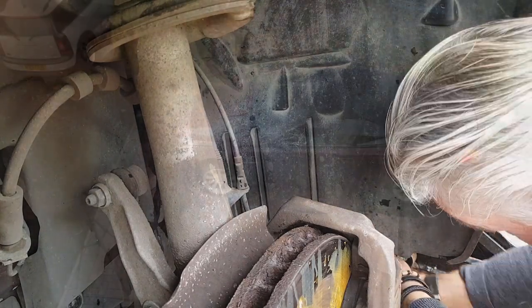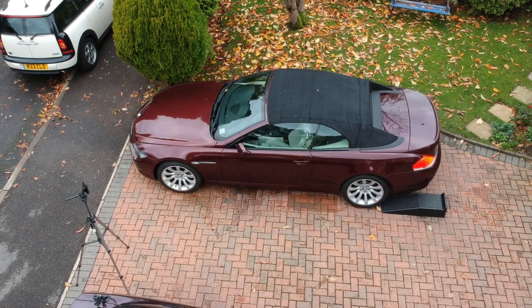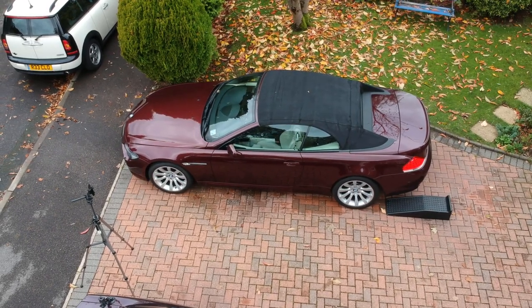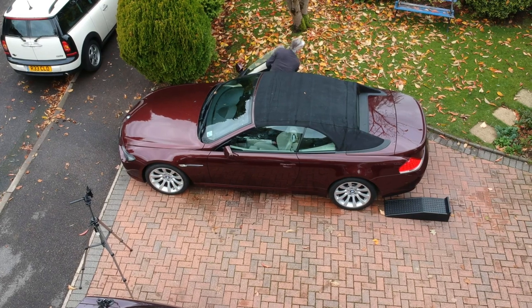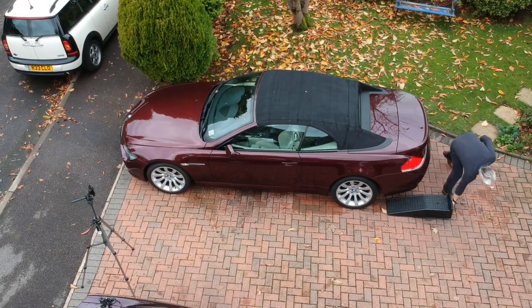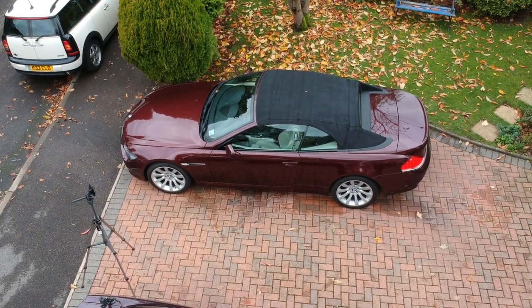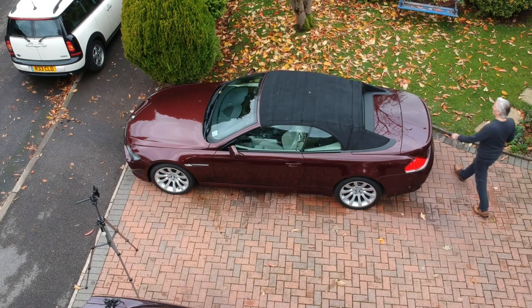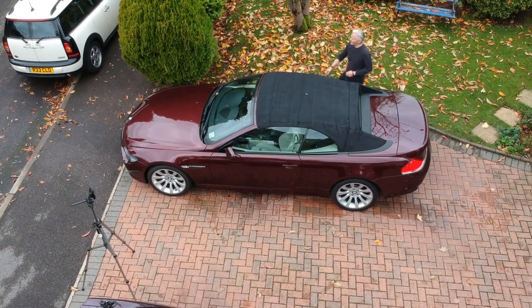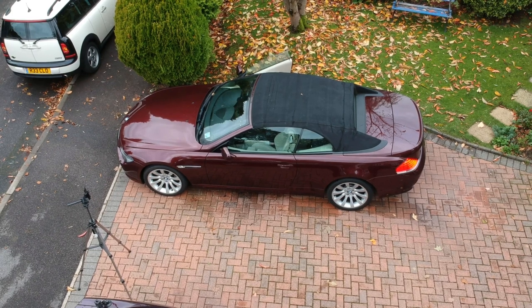So yeah, it's just a matter of putting the wheel liner back on. All those bolts, 8mm and 13mm, putting the wheel on and all the rest of it. And of course, when you put wheels on again, don't forget to grease the hub so that it doesn't get stuck on. That's the reason the wheel came off so easily, because if you grease the hub, then it's not going to get rusted onto it. Right, and we'll get on with all the other water drains now.